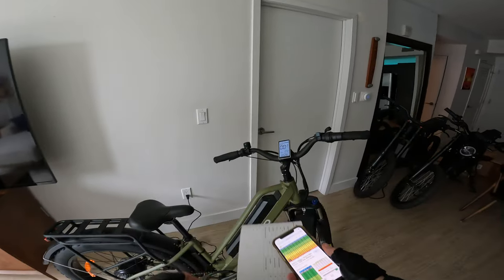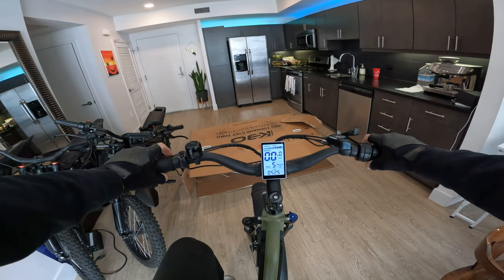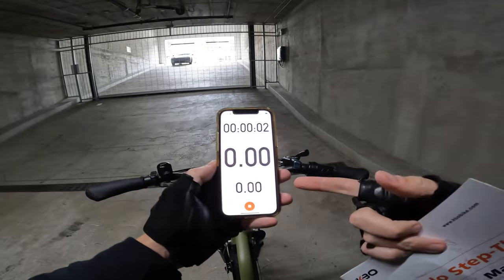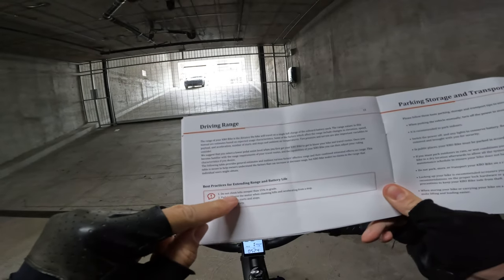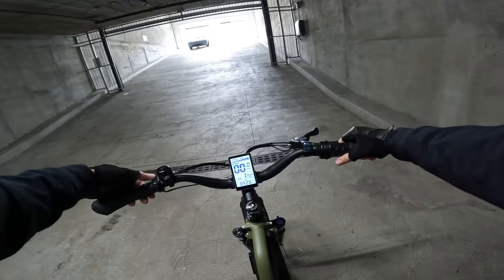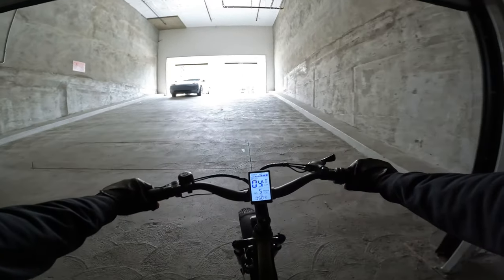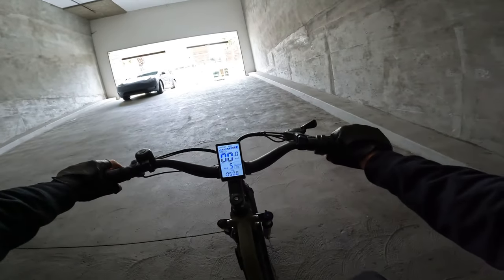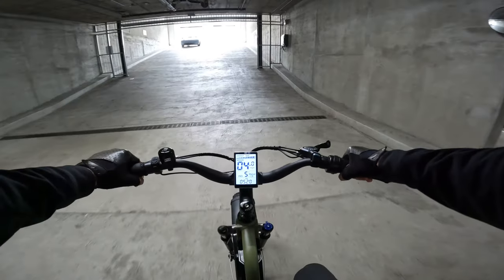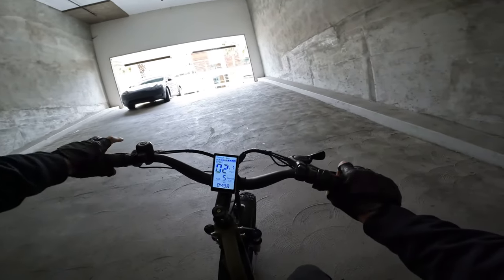Let's take the KBO Tornado out for a test drive. Battery says full — voltage shows 53 volts, which according to a 48-volt chart is about 90% charged. The owner's manual says do not climb hills steeper than 15% grade, but this is a 20% hill grade. We're going to start this review the same way we do every one — pedal assist 5, I weigh 200 pounds, full throttle from a stop. The bike actually kind of pulls itself up without pedaling, though it needs a little rollout. Not the strongest hill climbing bike on its own.